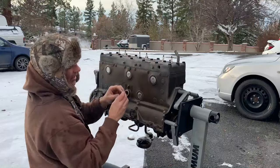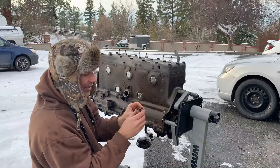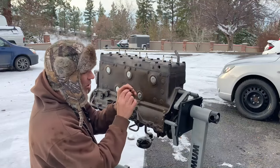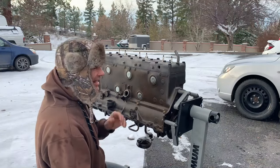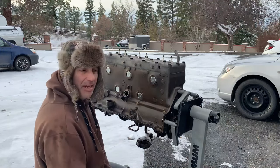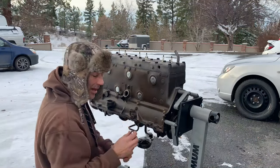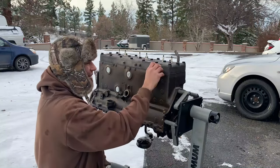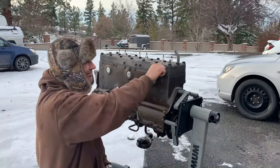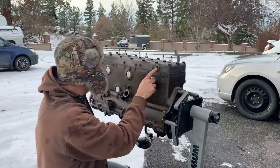And it's called a gland nut because it's got a special seat that allows the fitting to thread into it and seal. And this being a 1953 head, it had a smaller, incorrect temperature probe in it. This 53 engine was in my 38 Plymouth, and I could not hook up the temperature gauge. I just laid it on the block here, and it was as good as it could get. So I drilled and tapped the block for this gland nut for the bigger temperature probe now, and it will fit. That's one of the most exciting things for me, to get this car back together and get an accurate temperature gauge.